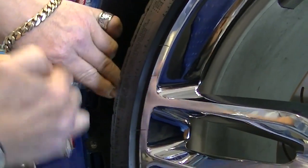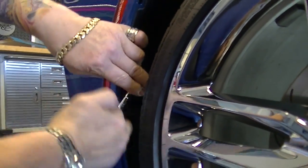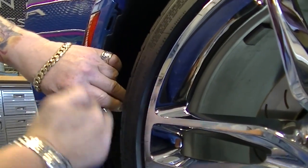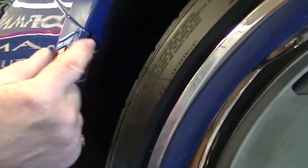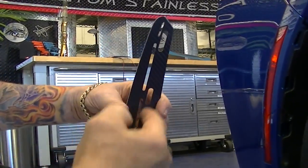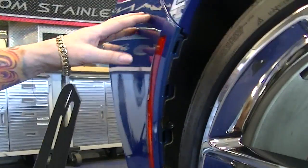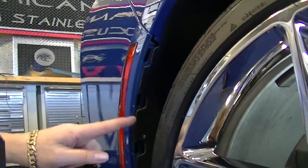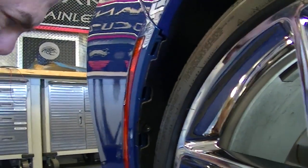The rear quarter fender on the C7 has some positioning extrusions, which we'll need to deal with. That's these little lines here. You see them? Now our filler pan, our mudguard, has notches to provide for that. However, on a lighter colored car, or white car, red car, blue car like this one, these become a little noticeable. So what we're going to do with those is black those out.